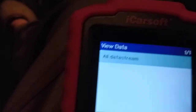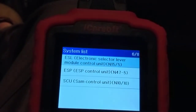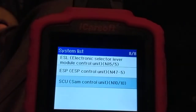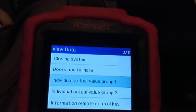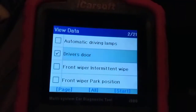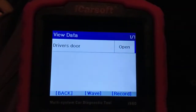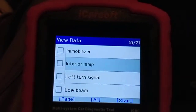Looking at the live data, there's voltage at the belt tensioner sensor. Under the seat — voltage at B48, seat occupied — we got four. If I push on the seat, the number goes down. If I push really hard, the 'passenger airbag not activated' light goes out. When I let go, the light comes back on. That's coming from this sensor, but it's fine.